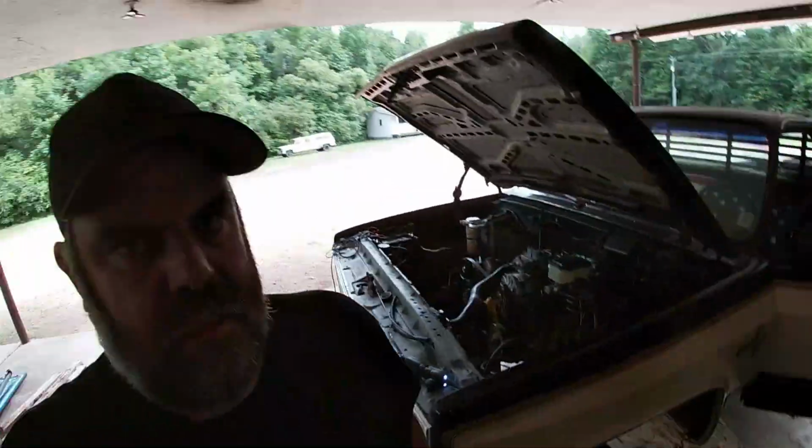We got our wire coming over, going to our thermal switch. And then we have our 12-volt ignition. I just found an empty ignition spot on the fuse box and I plugged it in there. So right after I go get the key, we're gonna turn the key on. When I turn the key on, we should hear a fuel pump pumping.